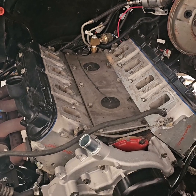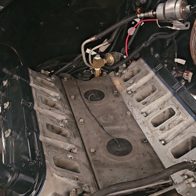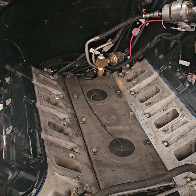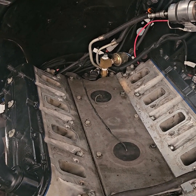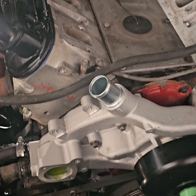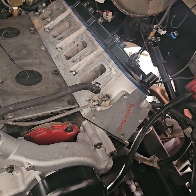Right, so we got the valve covers on, got the water pump on, also got the steam lines on as well. Back there, I don't know if you see it, where that oil pressure sensor is. I took that old oil pressure sensor out there that they had just blocking off. Put a block off cap up there. Had to get me some more clearance. And I'm about to throw on a new thermostat and housing, tensioner as well, and also the power steering bracket just came in, so get ready to put that on.